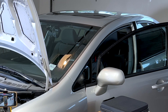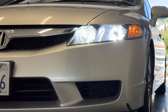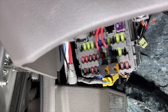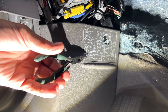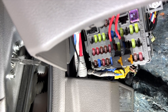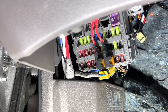I'm inside the car. I'm going to turn the key on, turn the blower motor on, then turn the lights on and wait 30 seconds. Then I need to disable the fuel pump and crank the starter. The easiest way to disable the fuel pump is the fuel pump fuse — it's number two, a 15 amp fuse. Over here at the fuse box, which is under the left side kick panel, I'll pull it out. Now the car won't start.